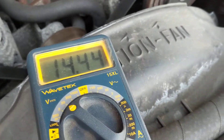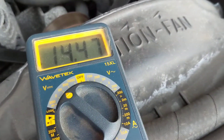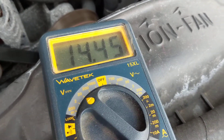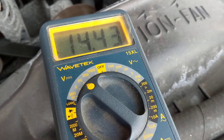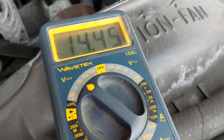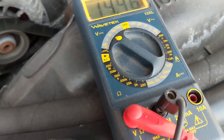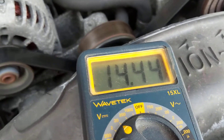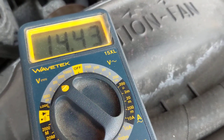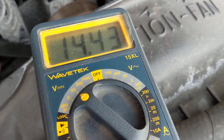Hello again everybody, our tutorial about outputs of the alternator. Remember, I explained before there's a regulator making sure that the output voltage stays constant regardless of the accessories or loads that are on. Before, if you saw the video I had, I had no crank but I had a battery — just putting the battery on with the lights, no engine running. At that time I drew about 15 amps. So right now the alternator is giving the current, providing the current and the voltage.